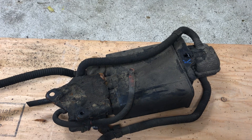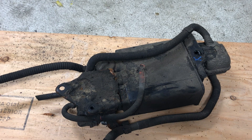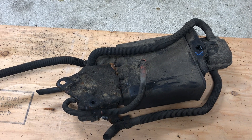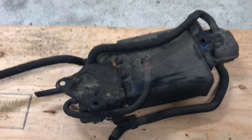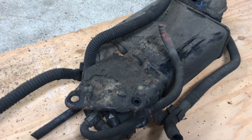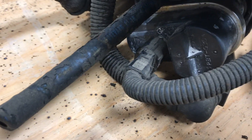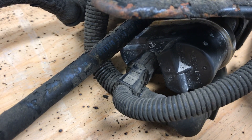But in 2005 when they went to the plastic tank, they relocated it, built into a canister which sits above the rear axle. So if you look under your car for the 2005 to 2008, you'll see this canister mounted above the rear axle, and right here this round shaped box attached to it with that plug — that's a leak detection pump.